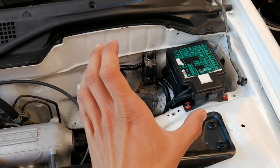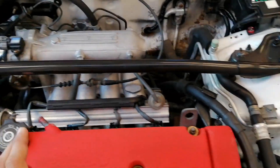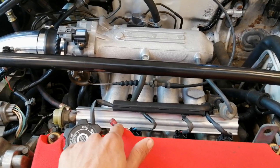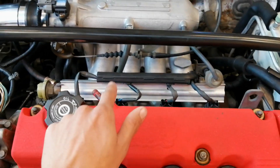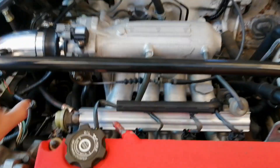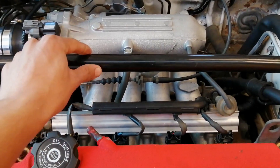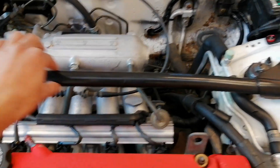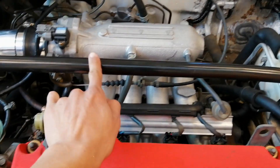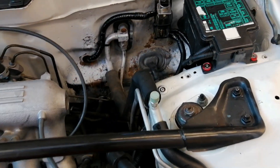The plan and goal for today's video is to get the oil catch installed in that area right there, or somewhere close to it. The problem I'm having at the moment is getting the piping hidden as it runs to the valve cover. I want the piping from this point to run underneath the strut brace, and I'm going to use some black cable ties to blend it in. I'll run it underneath the strut brace all the way through here and along this aircon piping to that area right there.